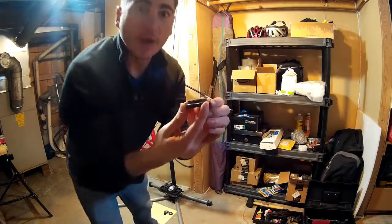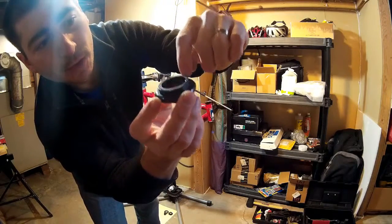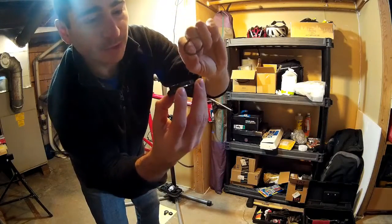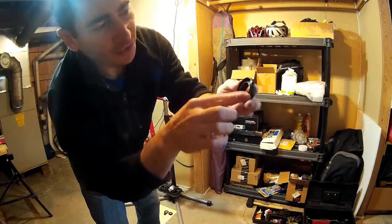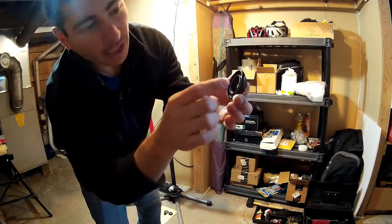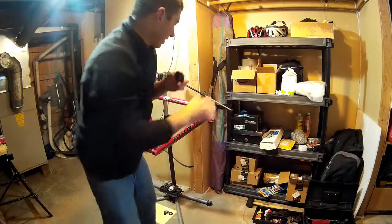So that was the threaded piece. I don't know if you can see it very well, but there's also a little tiny metal spacer here — you'll want to make sure you keep that. I'm going to go through and grease all these parts. This hollowed-out section here I'm going to grease, and I'm going to grease the threads as well. And then this is the little bearing race — this is where the bearings pop into.